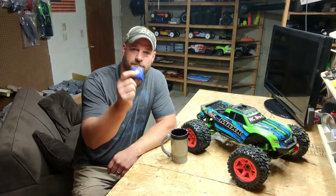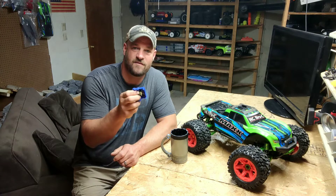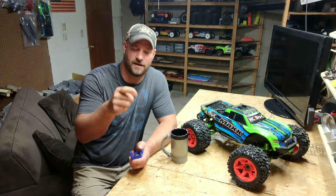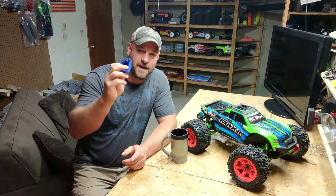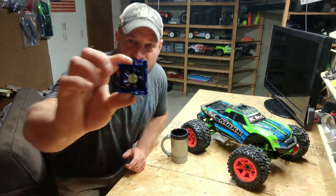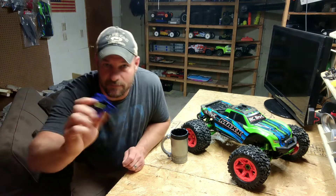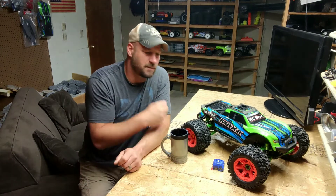Tip number one: the fan. Right away, if I were you I'd shim the fan. I have a video on my channel if you want to check it out. The fans bounce around inside the housing — as you can see on the inside there, I put a little shim on the side between this blue casing and the fan. It keeps it from moving around; just use a credit card. Quick easy fix — keeps your ESC from overheating, keeps the fan blades from snapping off, and cools way better when you've got your fins on there.